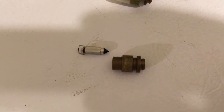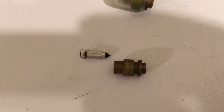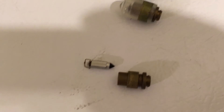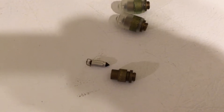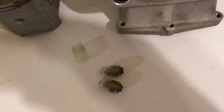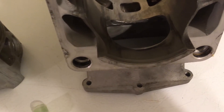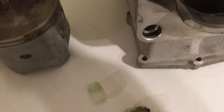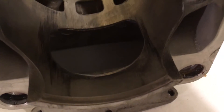The fuel was just pouring by that O-ring, and the needle and seat were pretty much useless at that point in controlling how much fuel was going into the motor through the carburetor. So what happened was there was so much fuel going into the motor that it was actually washing off the oil on the cylinder and the piston — there basically wasn't any oil in the motor. I caught it in time where there wasn't that much damage done, but there was enough that it scored the piston and the cylinder and took the chrome plating off.